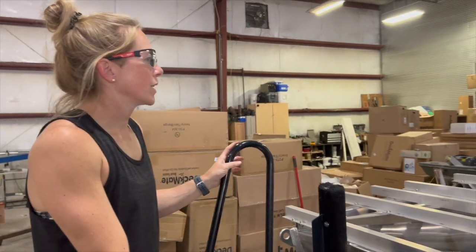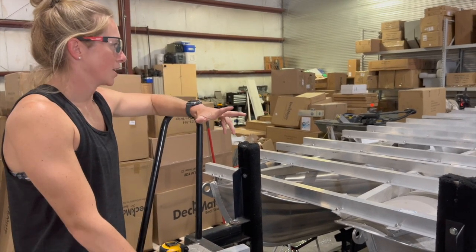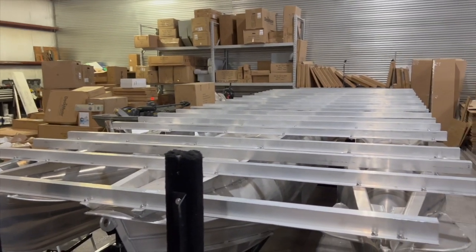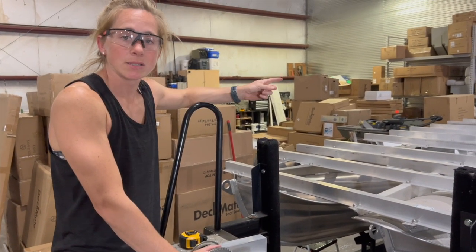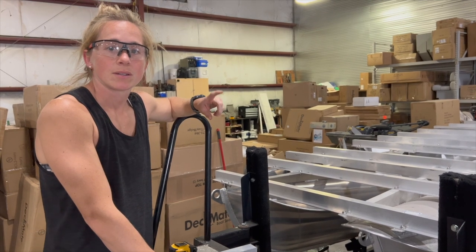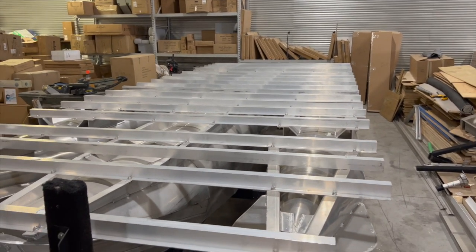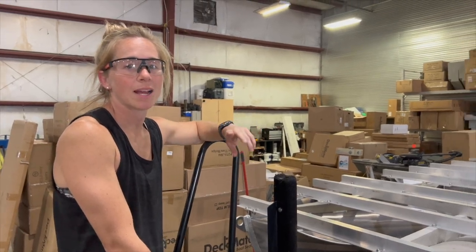We're about to put the floor on. When you buy a set of scratch-and-dent or cheap pontoons, just know you're probably going to have to figure some stuff out — it's all about problem solving. Normally we'd be able to lay full 4-foot by 8.5-foot sheets all the way down. We can lay the last one — the very back — at 48 inches, but then we have three or four boards we have to rip down to odd sizes like 40 inches and 38 inches, just because of where the cross members lined up. But it's going to be really sturdy.